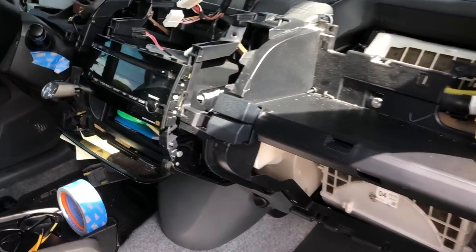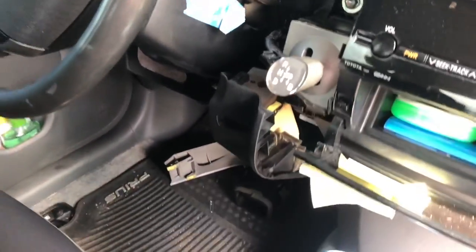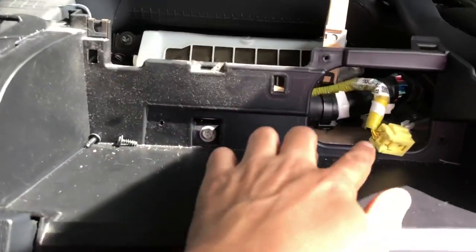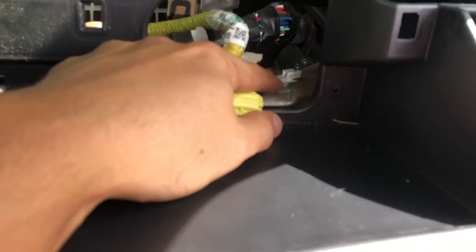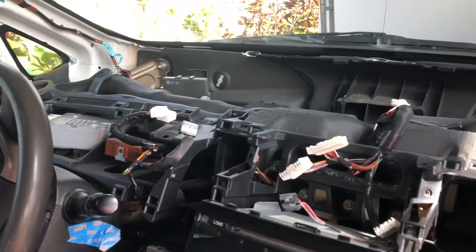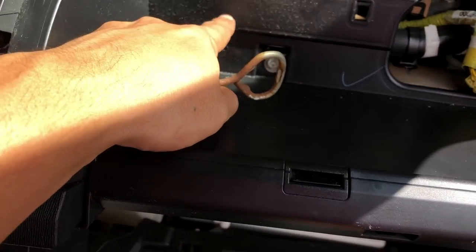This is how it looks with the dash panel removed. I watched another YouTube video — I'll put the link in the description below on how to remove the dash panel. I left this part attached still, it's just hanging. You can tape it up but it just came down. On the passenger side there's the airbag connector. In the glove compartment on the passenger side there are some clips you need to remove to access the screws.